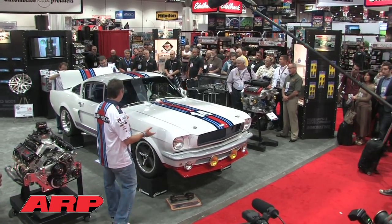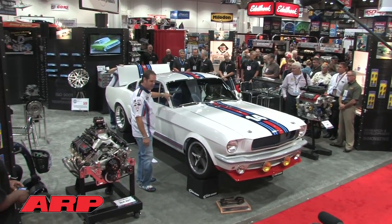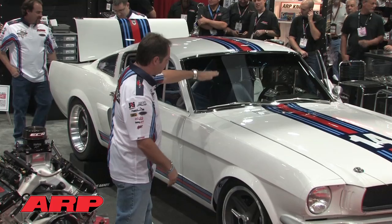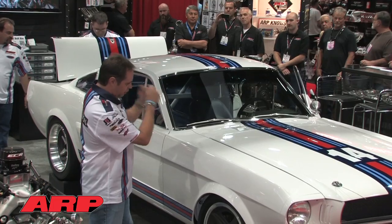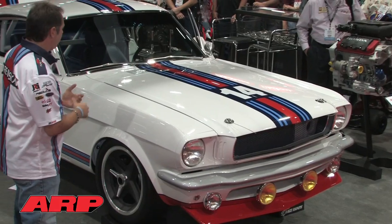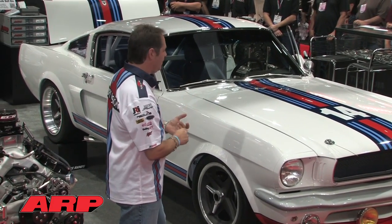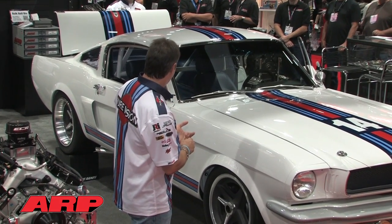Now the inside is also done kind of like a road rally car when you look around. Like on the A-pillar here, you're going to see an extendable map light and the navigator's footrest on the floor. Little things we did, like when you take the dash pad off of the factory dash, there are 2 metal frames that support the factory dash pad. I cut the one, put studs in it, and made it unboltable, and then Eric just covered it in some quick leather to make a neat little dash padette. The gauges are all Autometer movement, but we did them in German font. Redline Gauge Works did it for me. So a little bit of a Porsche throw to it. Again, with the theory of it being raced overseas, and you'll also see that sports car style seating in it.